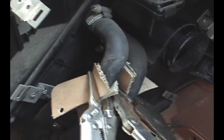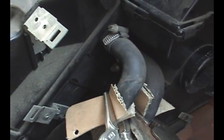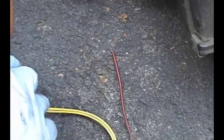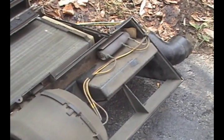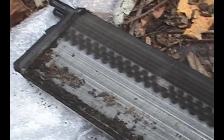I have not drained the coolant and I'm not going to — hopefully not. So I've pinched off these hoses and I'm going to take off these connections. Disconnect the rest of the hoses and then pull it out. Remove these two screws on top. By the way, I cut this red wire taking this out — it's probably going to be easier than getting it out another way. Remove all these clamps all the way around. You'll need to pry off the top. There is the old core.